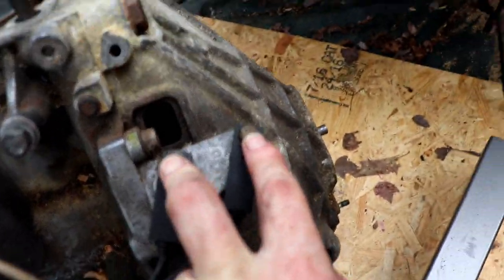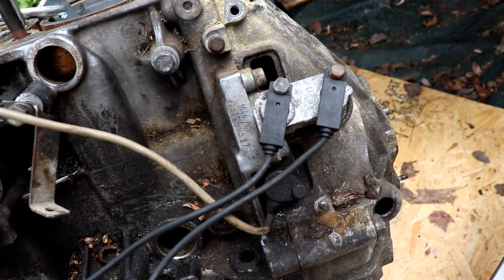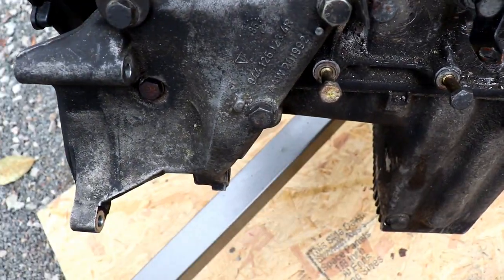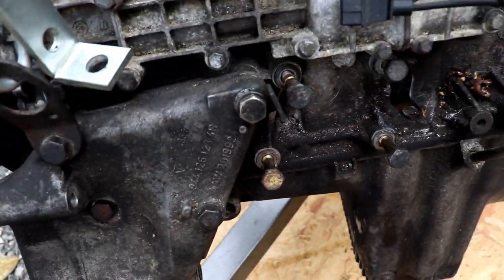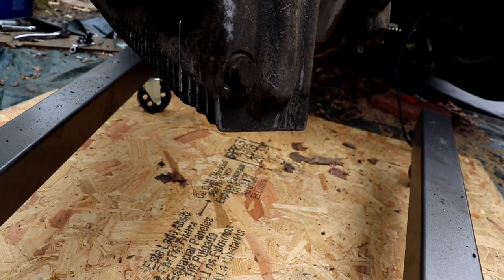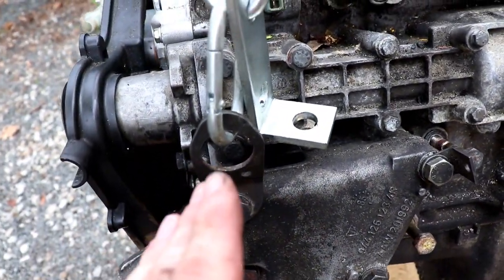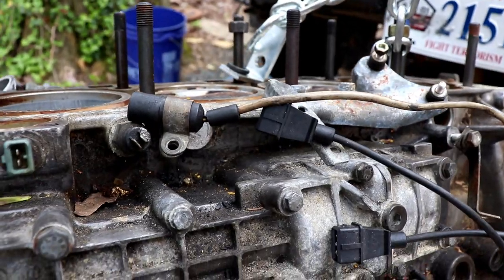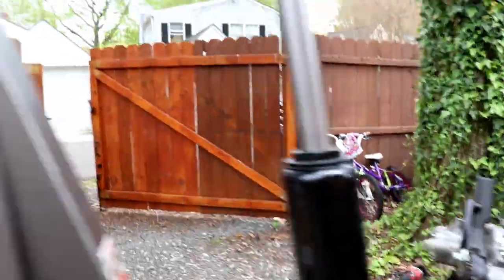You've got your reference and your speed sensors — hopefully I can figure out which one goes where and all the rest of the electrical. It took a long time to take this thing out and it took even longer to put it back in. I put the bracket back on for the alternator and AC compressor just so I'd have a different lifting point, because the engine turns a lot and it turns the long side of the oil pan down so it hits the crossmember. I thought if I put this back on and changed the lifting point it would help keep it straight, but as you can see it turns quite a bit. This bracket is going to come off because I'm replacing it.